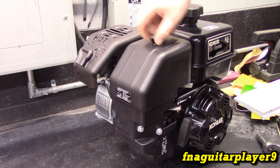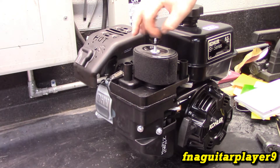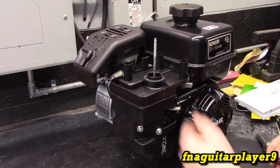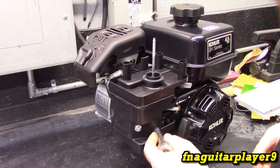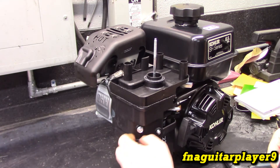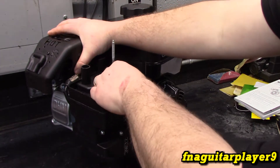The first thing we need to do is remove the air filter housing and air filter. This air filter looks the same as basically any Honda clone engine — the Predator engines. It's probably the same air filter. I call these the slant ones. You've got two 10mm nuts right here that you need to remove. Some of the clone engines will have a bolt going in up here; this one doesn't appear to. This air breather hose has got us now.